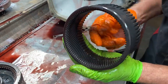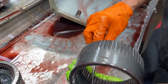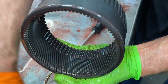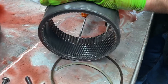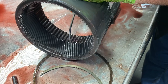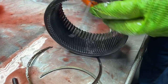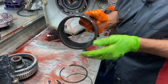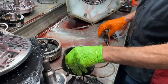You want to come in here and look at your ring gear on the inner and outer - you can see there's some metals already, some aluminum started getting batted into the teeth here, there's some pieces stuck in there. See all that metal in there? You just need to get in there and look at both sides of the teeth - your coast side and your drive side - and see if there's wear. If there's no wear, the ring gear is still going to be good. So it's just something you need to look at.